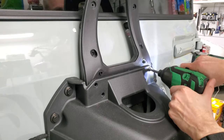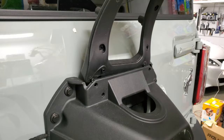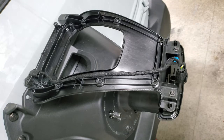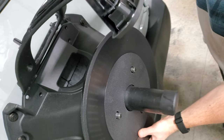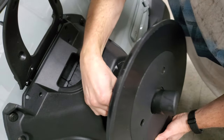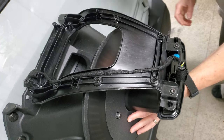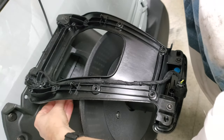I think the screws were just regular Torx, not Torx Plus, but I didn't look too close and my Torx bits seemed to fit just fine. After some fiddling, I was then able to separate the two halves of the third brake light housing and got the brake light harness unplugged. It was at this point I realized something was amiss — the hole in this thing was just not big enough for it to slide all the way back against the spare tire holder, meaning the studs wouldn't stick out far enough to get the lug nuts on. I don't know if this is an issue specific to Sasquatch-equipped models or not, so I had to scrape and cut a bit of the plastic off around the hole to make it bigger. I didn't record that, but it was easy — you definitely didn't miss anything.